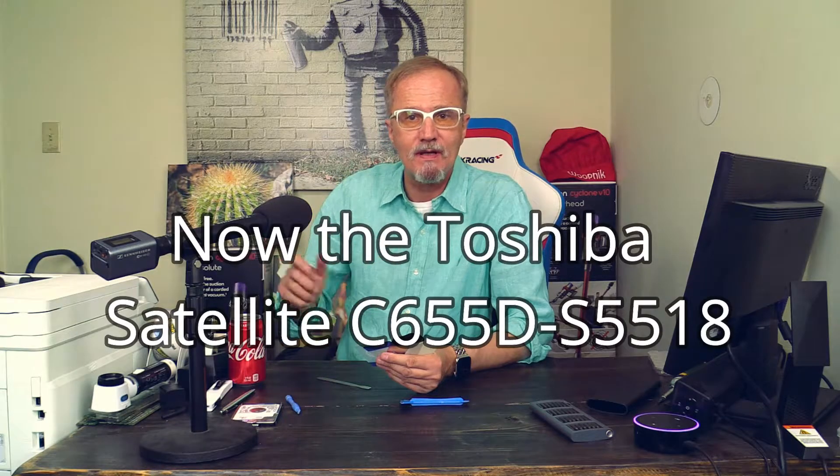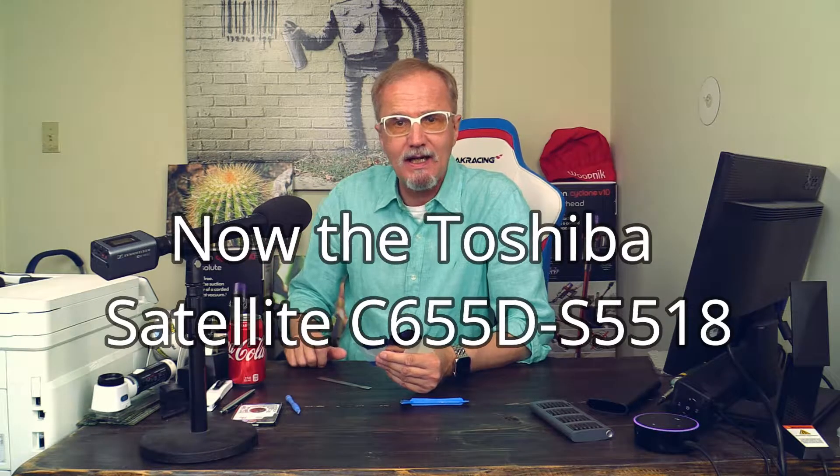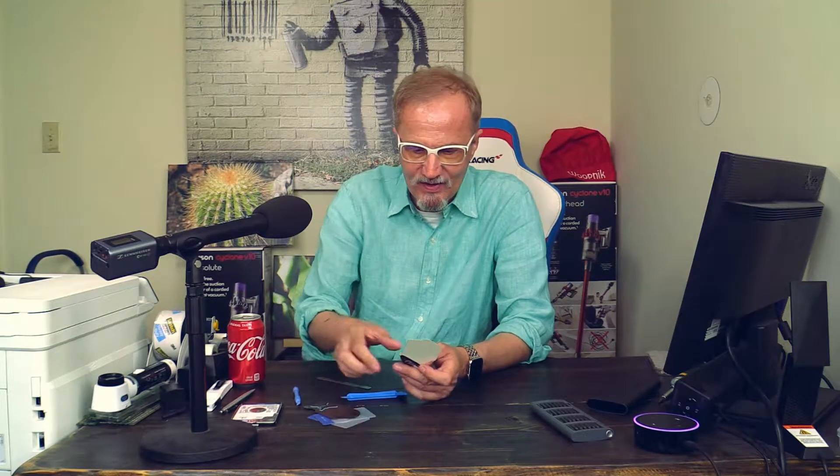Most laptops are not very maintenance friendly. If you can open them at all, some of them today are just glued shut, so forget about that. You need prying and opening tools to open this laptop. Here is a small selection — a plastic device like this, or a smaller version, very useful. Here are those cards, just to get into tight spaces and try to lift it up. Or here is something even thinner, kind of metal, to scoop something up, or here is the same in plastic. So you need these prying and opening tools in order to open this laptop.